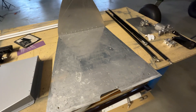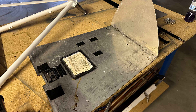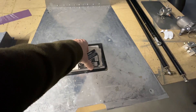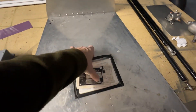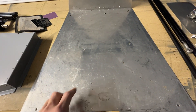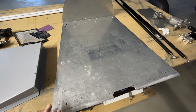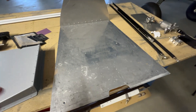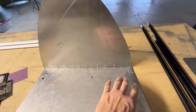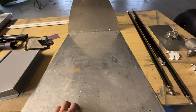This piece here is the inside of the turtle deck — kind of the baggage compartment in the Pitts. They had a little pouch riveted here for the paperwork and a data plate, so I drilled out the rivets and removed those. There was also some Velcro for different things; I took that off. My original plan was to use this as a template and make a new one because it was so nasty and dirty, but then I figured I don't have to make a new one. I'll just clean it up, sand it, prime it, and paint it. I've cleaned it all up and I'll scuff it, then put epoxy primer and white paint on here so that when you open up that baggage compartment it'll look really nice in there.